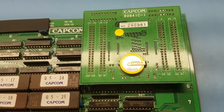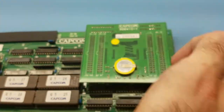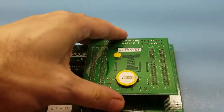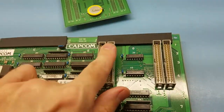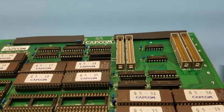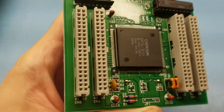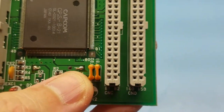But now we have another issue and that's the battery. So I'm getting my thumb under here and just applying firmly but controlled pressure upward. If you get a little too crazy with it, this thing's going to partially come up and you're going to bend these rear pins, and it's not good. So just be firm and gentle. I'm going to get this B board out of the way, and we have the C board with the battery — there are two leads that need to come out.